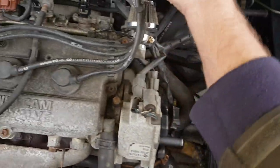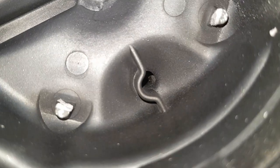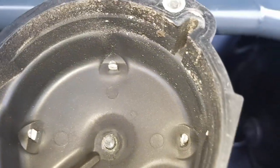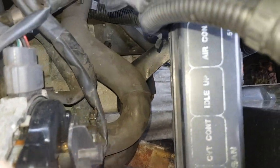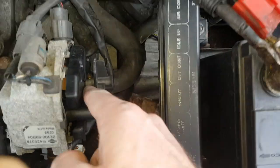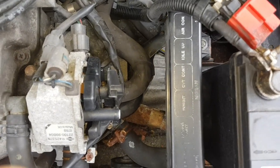Now that we've got the cap off, you can see all that white horrible stuff on there — it's starting to corrode, especially that one there which is quite bad. That wouldn't have lasted much longer. You can see all the shards of metal inside from it burning out. Now I need to get the rotor arm off, but this big mound of plastic is in the way so I can't get the screwdriver in straight. I'm going to flick it over on the key to spin the distributor around a little bit so I can get the screwdriver in nice and straight.